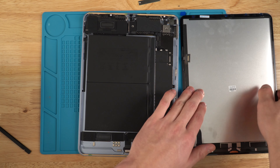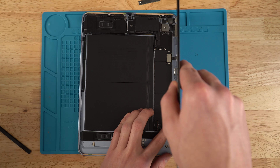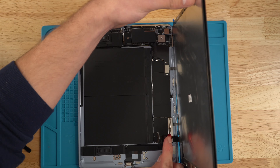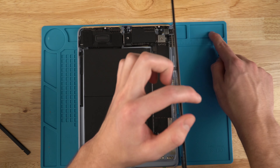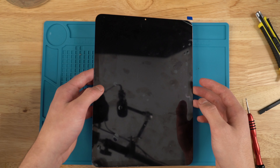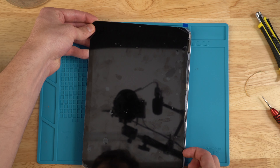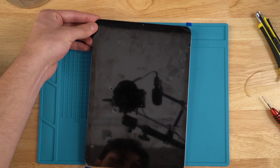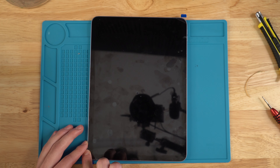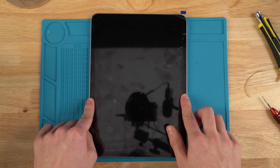Now apply pressure on the ribbons and put them into place. Grab your Phillips screwdriver and put the shields back down — do not overtighten the screws on these shields. Once that's done, remove the protective tape. Guide the bottom right corner into place, then line up each of the remaining corners, making sure the screen is all symmetrical and lined up.